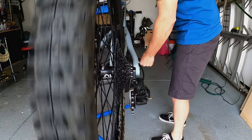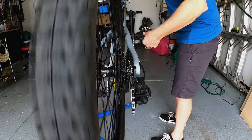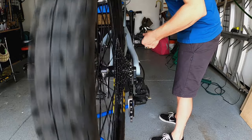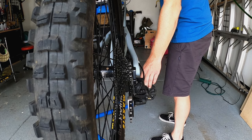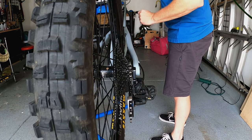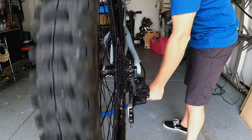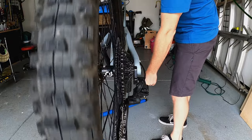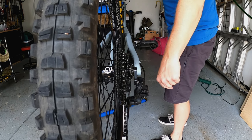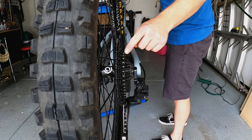Here we're going to pedal along — right now we're in the smallest cog on our cassette, which is the highest gear, so this is the hardest way to pedal. As you click the shift selector to go down or lower in a gear, the shifter cable shortens and pulls the derailleur inward toward the wheel a fixed amount — that's why they call it indexed shifting — while stretching the spring. Conversely, as we move to a higher gear the shifter cable extends and becomes longer, allowing the spring to compress and pull the derailleur away from the wheel to the next smallest cog on the cassette, using the ramps on the teeth of the cogs as a mechanical advantage.